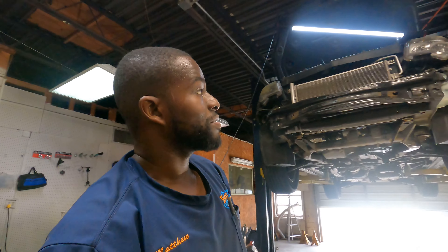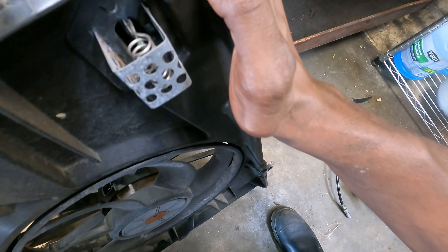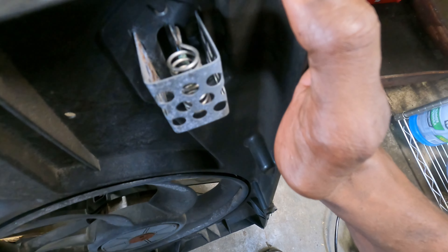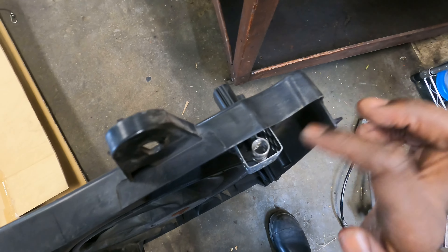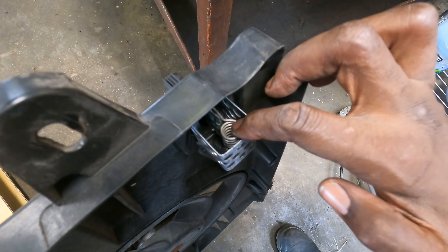It's amazing how it's done in an hour. But honestly, let me know if the book says 2.3 hours — can you do this in one hour correctly, putting 100% of the fasteners back in the right places and doing quality work? Since the vehicle was overheating, I found — I don't know if you're going to be able to see it — the resistor itself, and also the solder had broken off here on this fan motor. Nine times out of ten that caused it to operate intermittently and caused it to overheat. So that's a good catch right there, by paying attention and just looking at things.